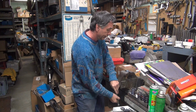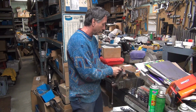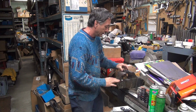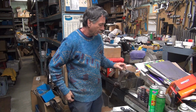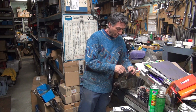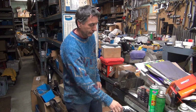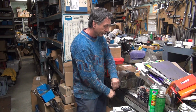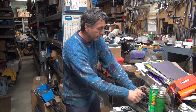Got two at home now. Those two match. See, normally the inner spring coil binds and the outer one barely does. You got a big gap. See, now we're probably coil bind on the outer one. That's why they're going in deeper. Which means the collars are different heights. Ew, this one sucks. It's 31. It's 32. So that one goes here. There you go.